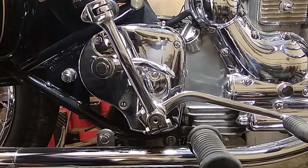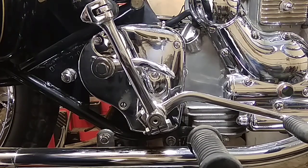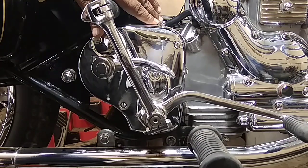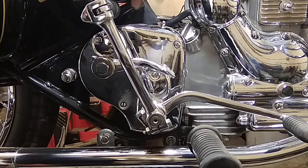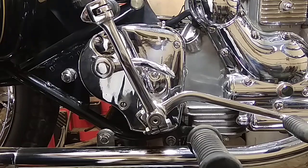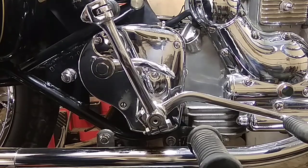So let's begin with the repairing. Right now I have to fill up the lubrication system in this four-speed gearbox. Older generation bikes were having a four-speed gearbox. This bike requires 00 grade grease, which is not available in the market because it was basically OEM supply — the supplier was only giving that 00 grade to the company. It's still not available in the market, so there is an alternative which I am going to share with you, so stay connected.